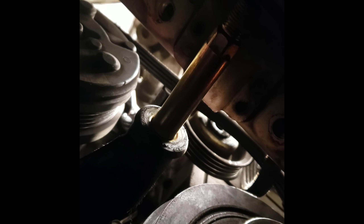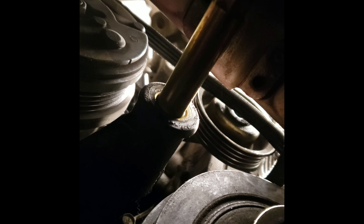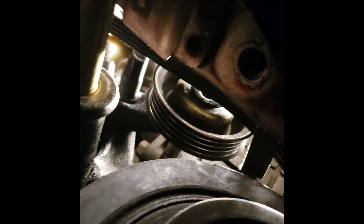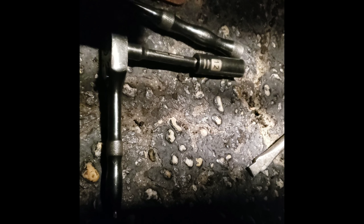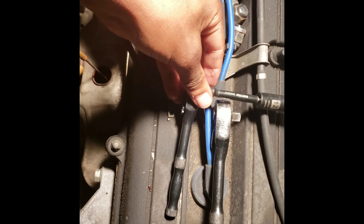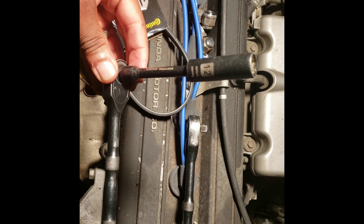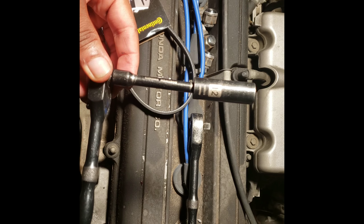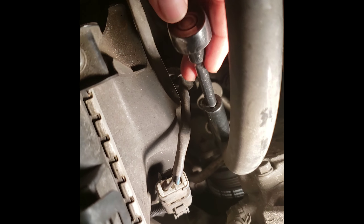You back it out so that you can get it to come down far enough to get this belt over the top of it. And then once the belt is over top of it, you screw it back in to push it back up. A 12mm slightly extended mini wrench will get you a little extension, maybe about 2 inches, plus a long socket so that the bolt can slide up in there and you can get to the nut. Then you are going to come at it from the radiator side.